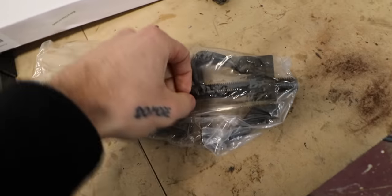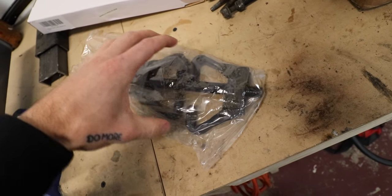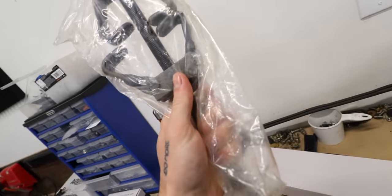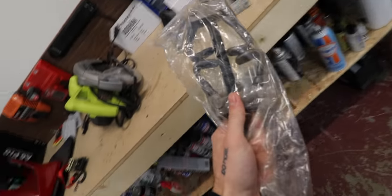So the truck has been sitting here dead the whole time. I ordered a new spring compressor — it's supposed to be an inside mount one. These go up the center of the spring and grab it. Just a reference for anyone that's ever gonna take that spring out: don't do it unless you have an inside mount spring compressor, because there's just no way to get it back in otherwise.